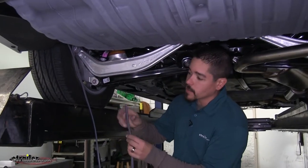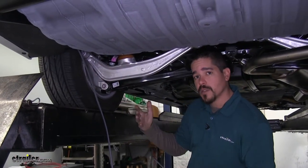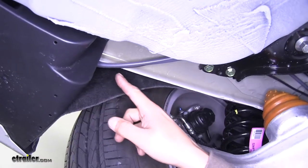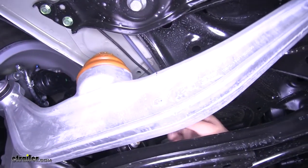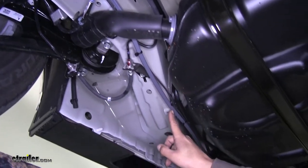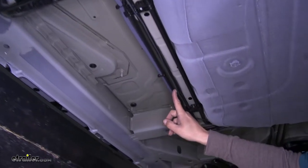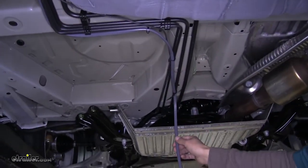As mentioned, we are going to have to run our gray duplex wire up to the front of our Odyssey. Make sure you stay away from any heat sources like the exhaust or any moving parts like the steering or suspension components. My wire started from right underneath that panel, routing towards the front above that bracket and above the subframe, came back down by my fuel tank filler, zip tied it to some existing wiring, then routed it along the factory brake lines and fuel lines, and have it coming down right here by the belly pan.